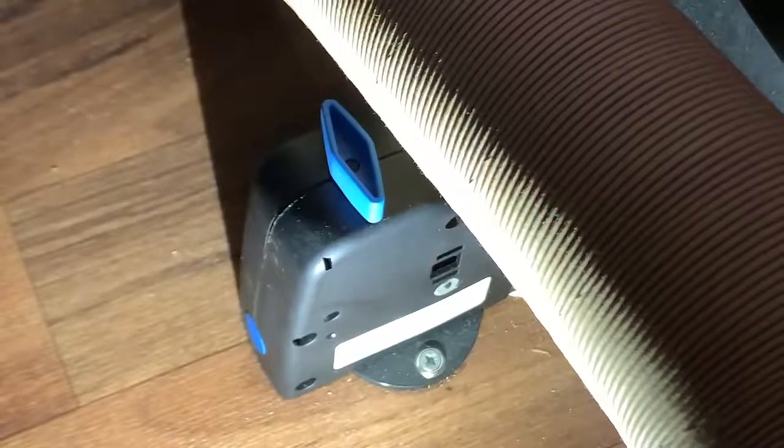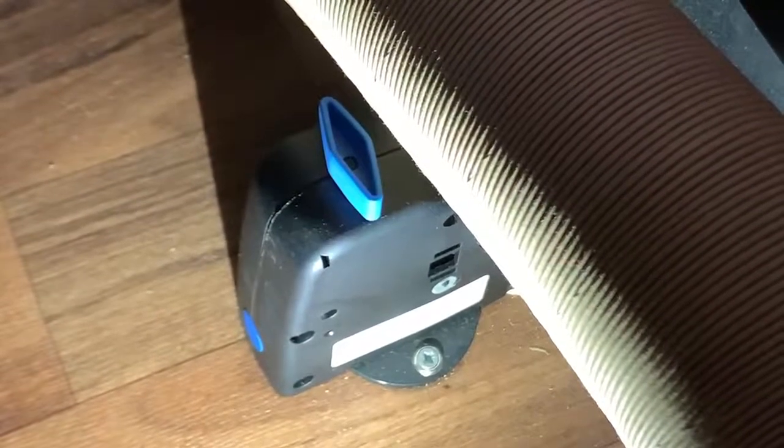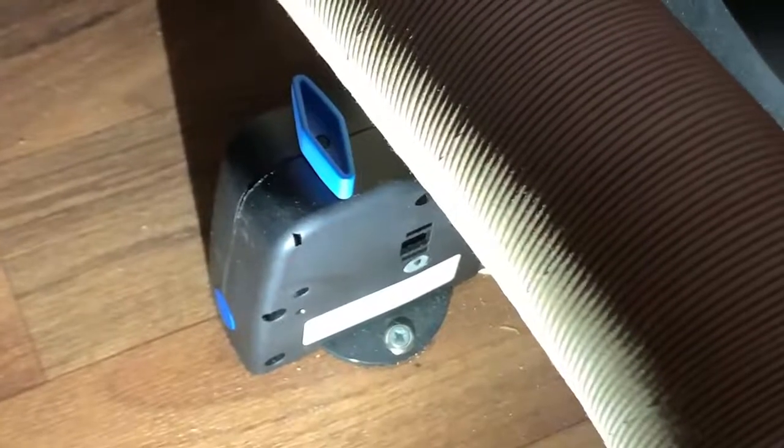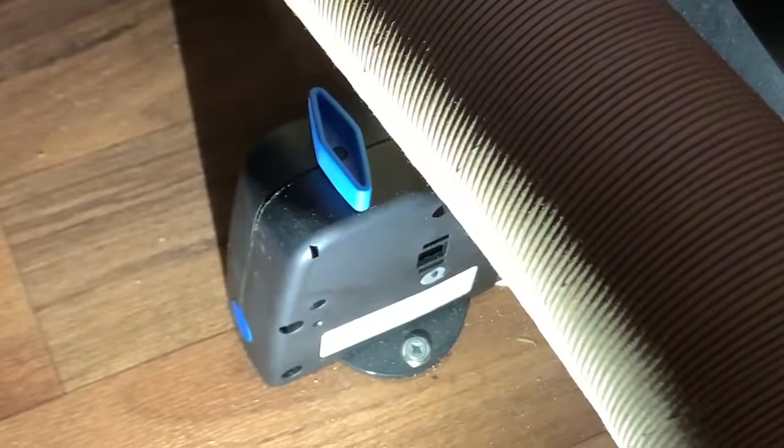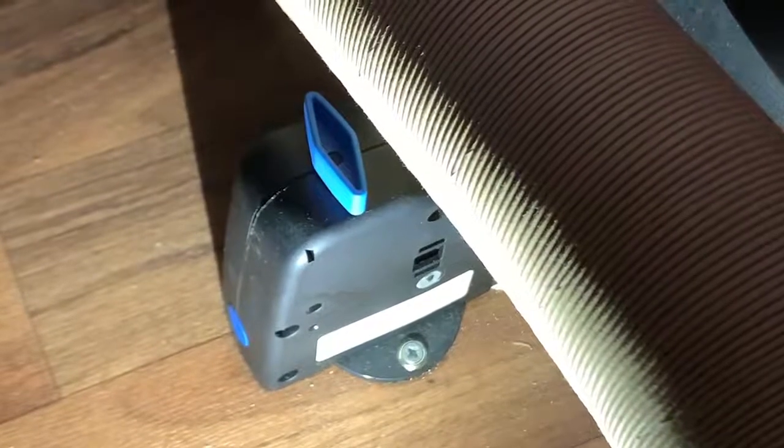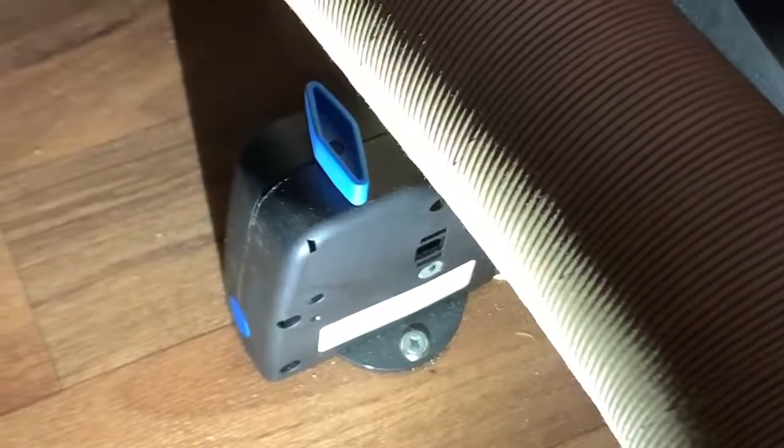If you're unaware of this, you can then go to set up for your next holiday, fill the water tank with water and turn your water pump on, only to find you're now purging everything right at the bottom of the vehicle once more — because this valve is open when you assumed it was closed.